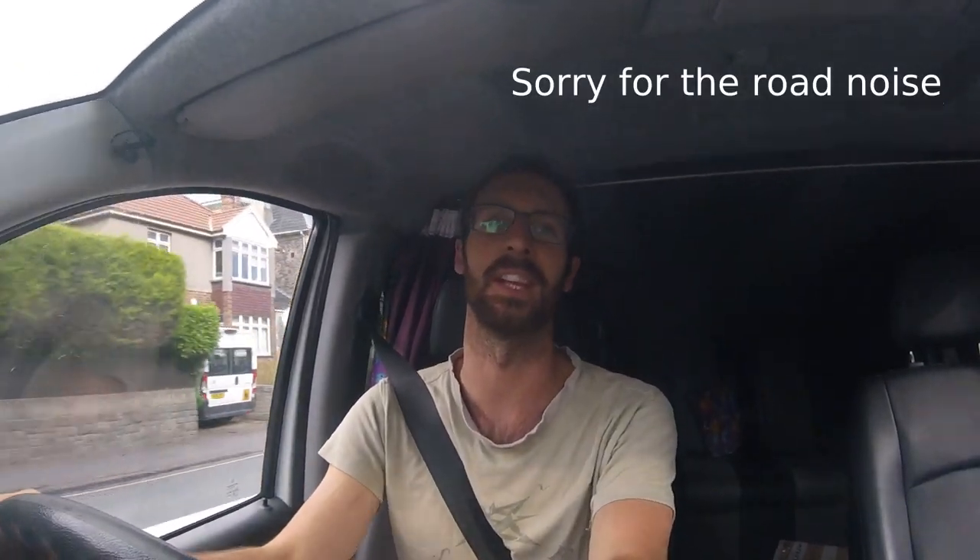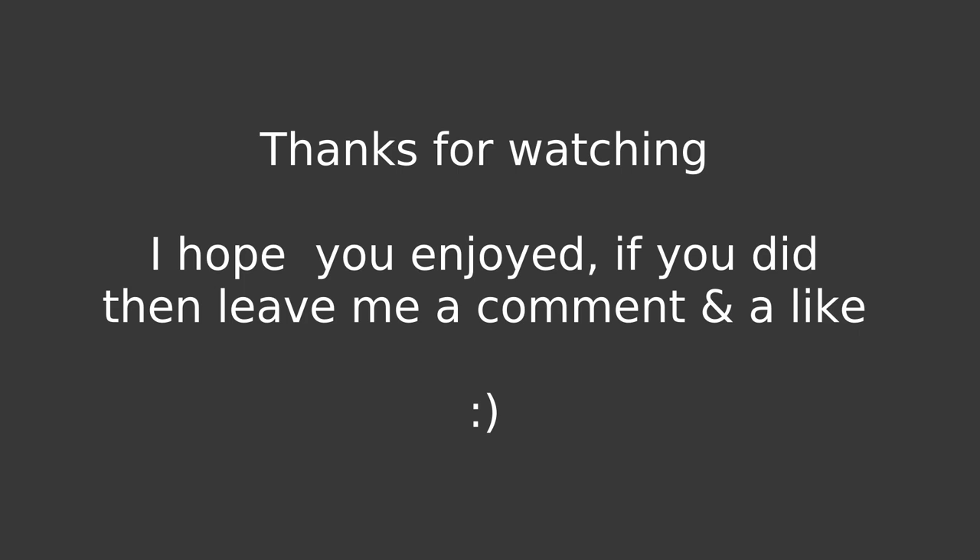I was always going to jinx it saying I'd get the car driving this episode, but we did get a lot done today. We've got the hubs on, the brakes on, and the anti-roll bar is on. The last thing to go in now is the shocks, but I'm getting tired — rather than make mistakes I'll come back fresh next time and get those last bits sorted out, do a final nut and bolt check, and there are still the split pins to do on the wishbones. Hopefully we'll get that done next time and maybe get her driving.